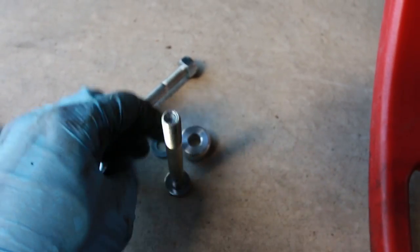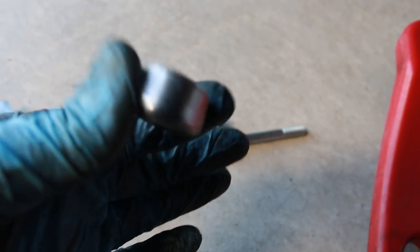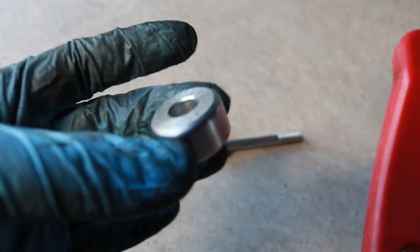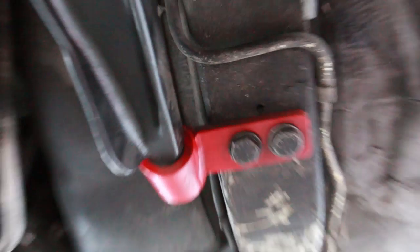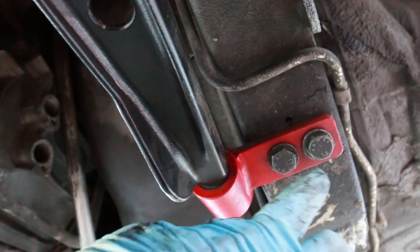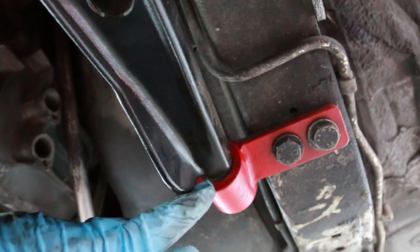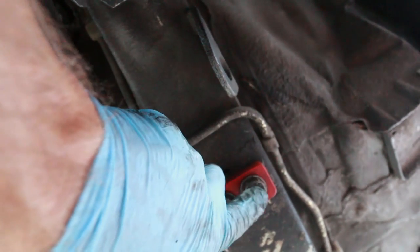I'm going to attempt to use it without the spacer. These would also work as steering rack spacers — if you did an E36 or Z3 steering swap, you could put these on top and they would work. As you can see, I have my skid plate installed. I just went ahead and put this bolt in real quick to keep it lined up. Now I'm going to remove the 17mm bolts keeping in my lollipops. These are Garagistic treehouse mounts — kind of an M3 style — a solid Delrin bushing. They work really, really well.